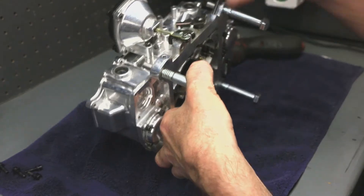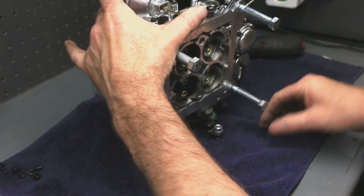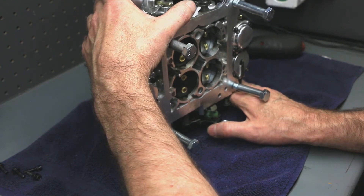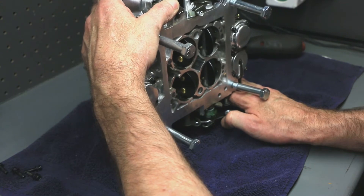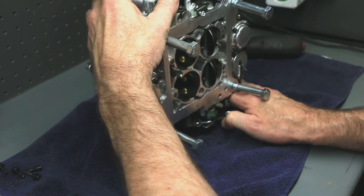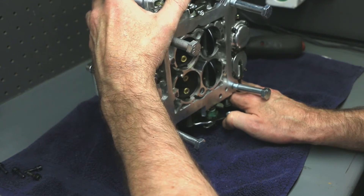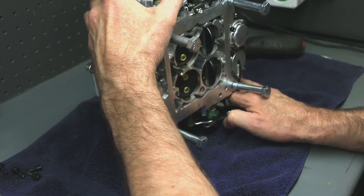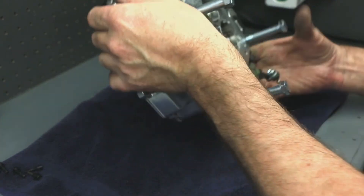Other tuning is, of course, your secondary diaphragm. The way these work is when you're on the throttle and there's airflow through the primary venturis, it creates a vacuum that opens up the secondary once that vacuum level is reached — and that's determined by the spring in here. So it's airflow through the primary that opens those. It's kind of a cool on-demand thing — when the airflow through the engine is high enough that it needs more flow, those will open up. I like vacuum secondaries; they run much better.